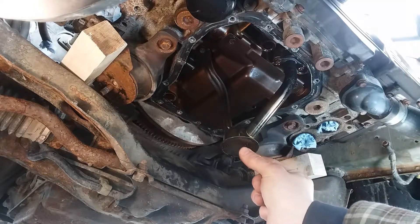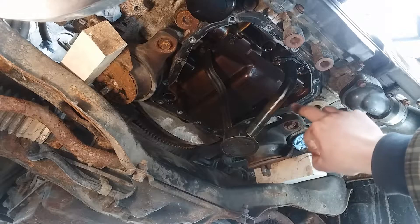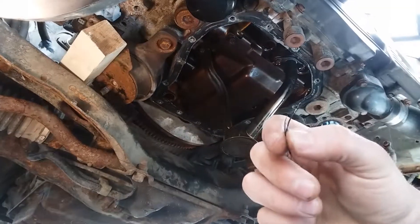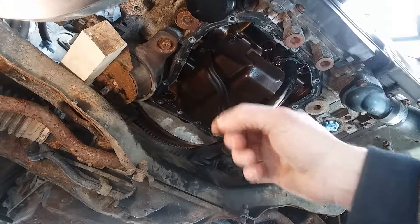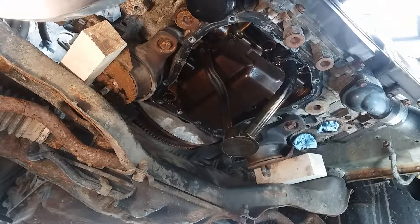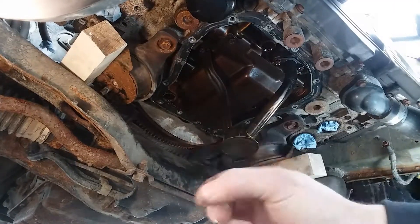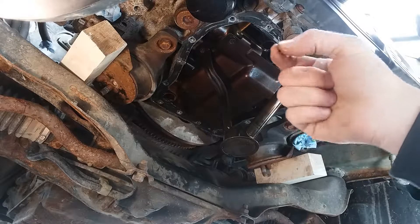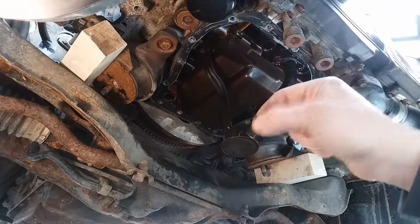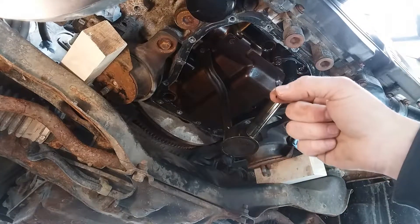All this right here — when you put sealant on and it squeezes and compresses, there's always a chance of it coming loose into the pan. That's why they make anaerobic sealants: in a non-oxygen environment, like the space between the pan surface and the engine block surface, it cures properly. That's what that debris is right there in the bottom of the filter screen on the pickup. Stuff like that can get into your oil ports and passages, so you've got to be careful not to overdo it.